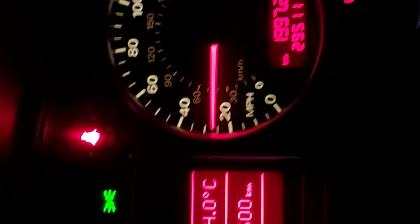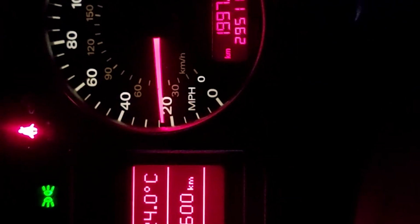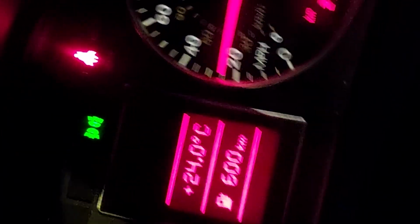So now that I replaced those slider bushings on the slider pins on the left side, which is where the noise is coming from, I haven't heard it so far, but I'm gonna reserve judgment for a few days, and then I'll get back to everyone and let them know if that resolved my issue.